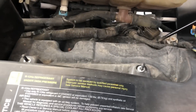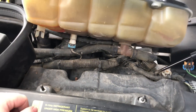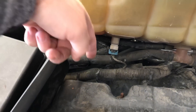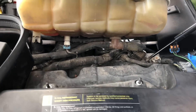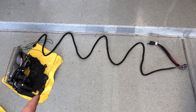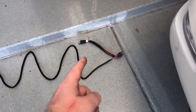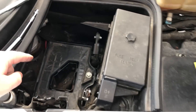The first thing on the passenger side is to undo the screws for the coolant tank so we can tip it up out of the way. The nuts holding the coolant tank are 10mm, and to get to the third one you'll need a deep socket to reach around the back side. Then just tip it up out of the way. Grab one of your wiring harnesses — the end with the green wire going out goes to your headlight, and this other end goes up towards the cabin.